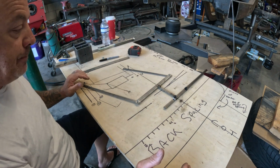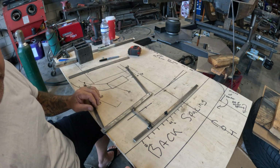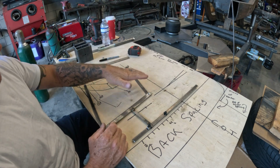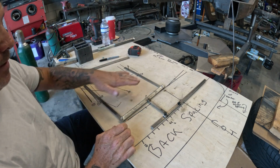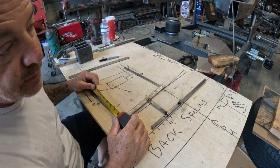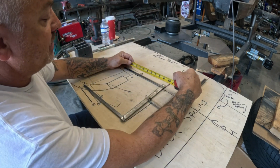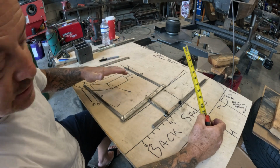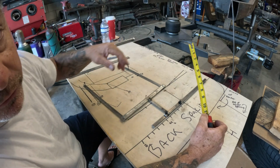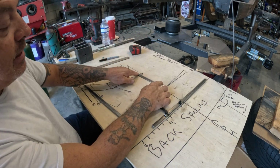It's very simple. It's very rudimentary. I mean, there's nothing to it, but this is how I'm going to design the suspension for the Crew Cab S10, and it gives me a ballpark on how long I need to make my upper and my lower. And just to give you an example, like a Michigan Metalworks tubular upper control arm, I believe is around 7 inches, based off of a stock suspension. We're at 9 inches. And that's because I narrowed the width of the frame rails, installing mandrel bent rails, versus a stock S10 chassis where you would be left with a little itty bitty arm like this.